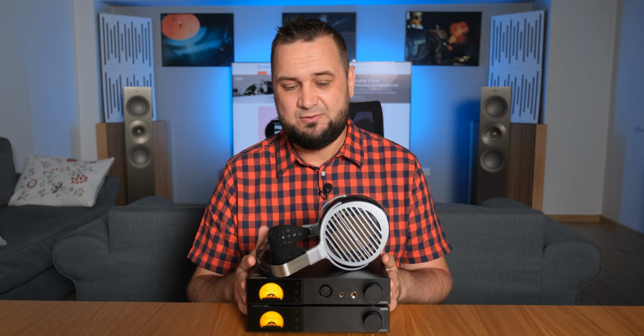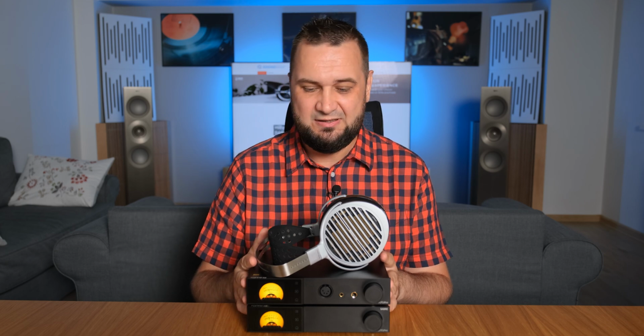With Sennheiser HD 800S, that would be minus 25 dB on its volume wheel, so plenty of headroom remaining on tap. And with the HiFiMan Susvara, for the same SPL of 108 dB, that would be minus 15.5 dB of volume still remaining on tap. So that is a lot of power. I'm reminding you that this is not my actual listening volume. With the Susvara, that would be at around minus 20, minus 22 dB. So again, it feels like having a lot of headroom remaining on tap.